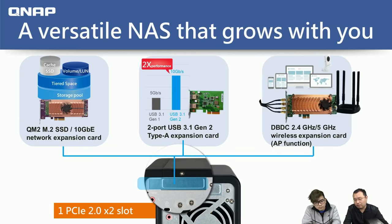Another useful option is that more vendors like SanDisk and WD are releasing SSD-based external drives with USB Type-C and USB 3.1. You can install a QNAP USB 3.1 card to get USB 3.1 10 Gbps speed and perform very fast high-speed backup with those SSDs — over 500 megabytes per second with USB 3.1.